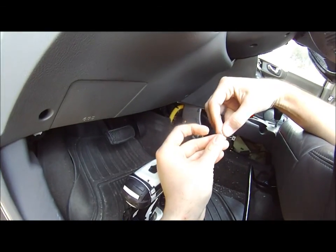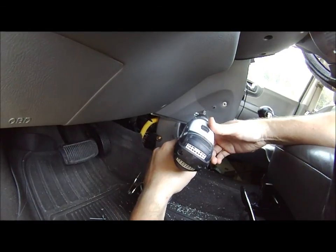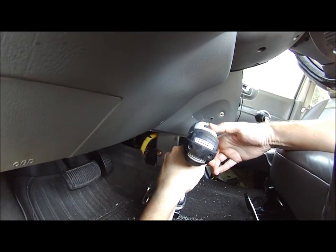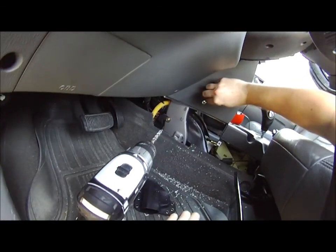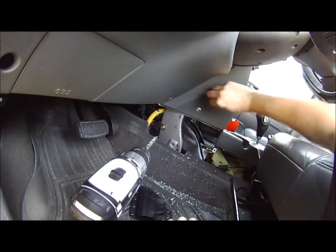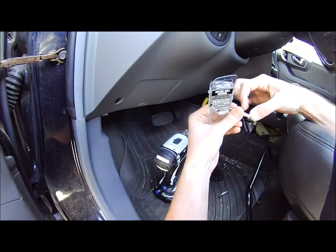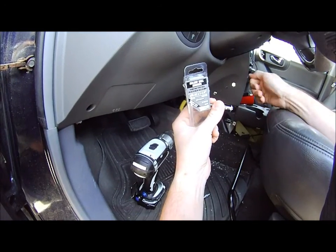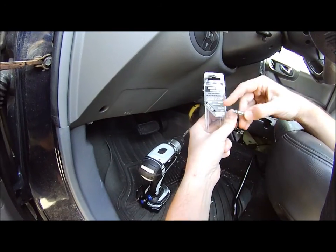This is that white plastic I was talking about — it's back there behind the panel. These are the hollow wall anchors I'm using. I measured the material thickness last night by sticking a punch in there and then pulling it out and seeing how much was left on the tip to get an idea of how thick the material was.